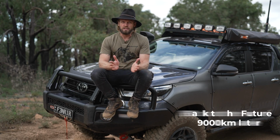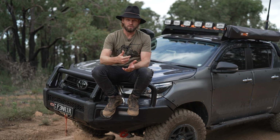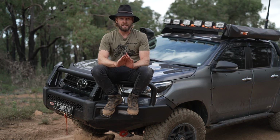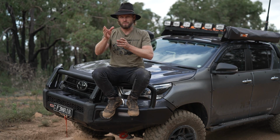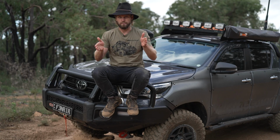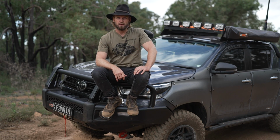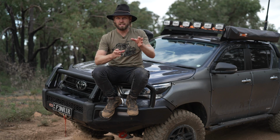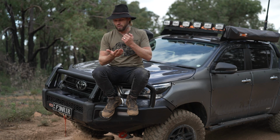Now, as I mentioned at the beginning, with them being BP51s with adjustable rebound and compression, I haven't touched that setting at all. When it was first put in, it was set to, I think, 6 on rebound and 5 on compression. It goes from 1 to 10. I haven't mucked around with it because I found the vehicle behaves really well. And that's not the reason why I went for that suspension. I didn't go for it because I can adjust it. I went for it because it had remote reservoir, and Torben raves on about it.